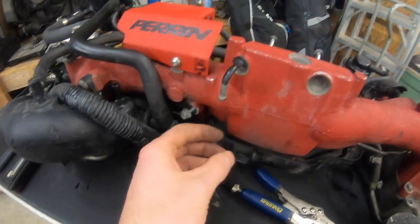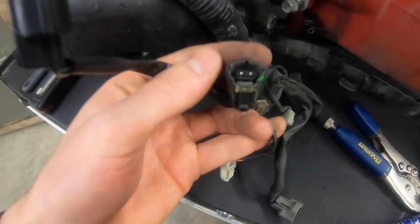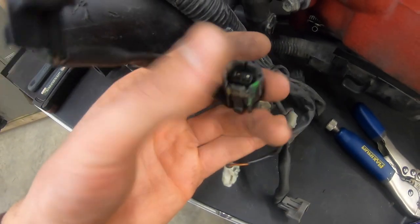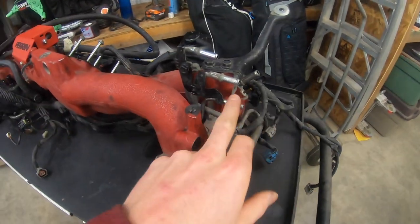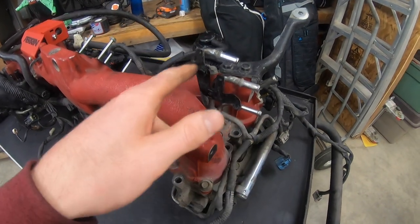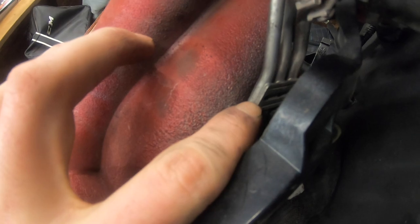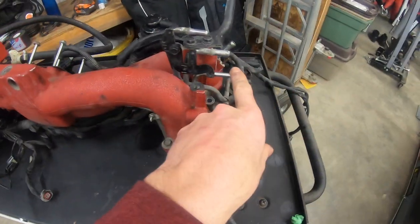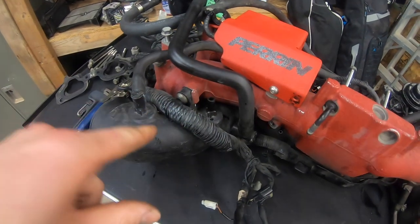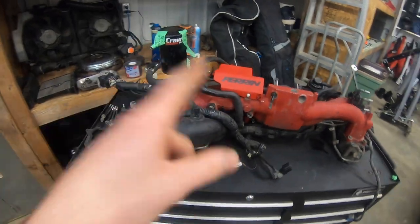It gets rid of that whole rat's nest here. Honestly, just electrical tape off these two plugs here. If you're running the stock fuel line still, it's a lot of work to get this line off of here because it is attached by brackets to the other lines. And on the bottom, it is actually welded to a bracket right there, if you can see it. Yeah, right there. There's a bracket welding all of them together. So just put block off plugs there, there, there, and here, if you're running the stock turbo inlet. That's how you do a purge valve delete.